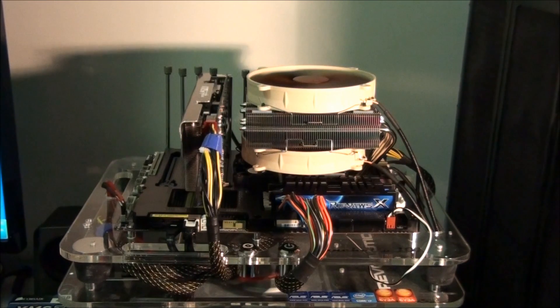So certainly some interesting results there. If you're wondering why the CPU temperatures are so much hotter during the downward blowing CPU cooler testing, it's because in the other tests I was actually using water cooling on the CPU. When using the downward blowing CPU cooler, 4.8GHz is a fairly high overclock for that particular cooler — that's why the CPU temps are so hot. Make sure you check out the previous videos; I've put the links up on the screen so you can see the water cooling details.